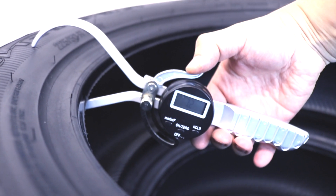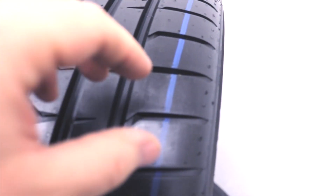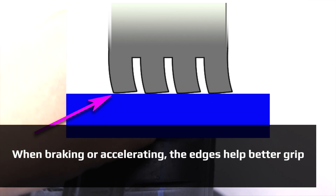The sidewall thickness is one of the characteristics showing how durable the tire is. The norm is from 5 to 8 millimeters; here it measures 7.2 millimeters. The tread is asymmetrical with wide drainage grooves and small grooves that help with drainage and grip due to the edge effect.